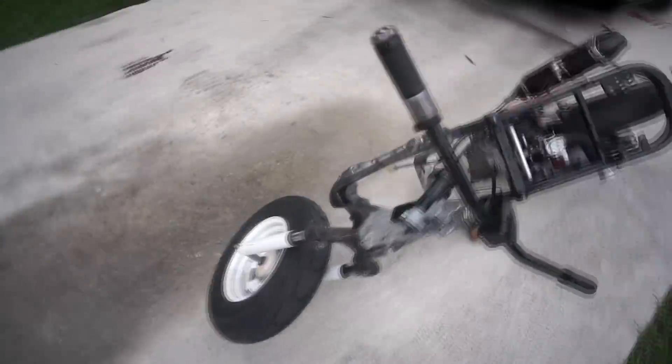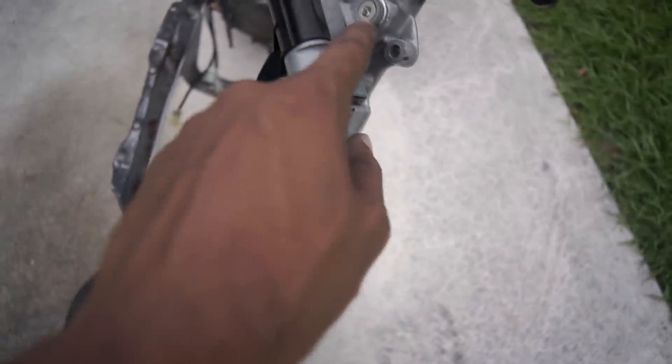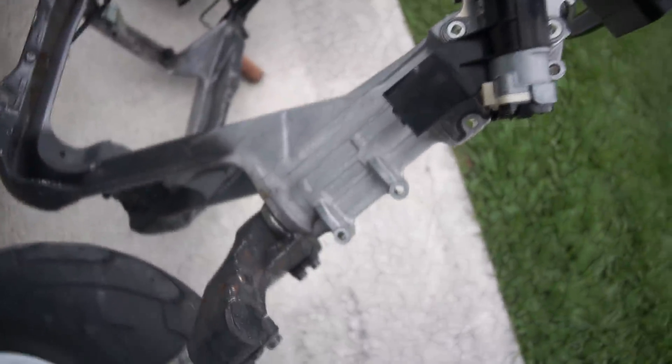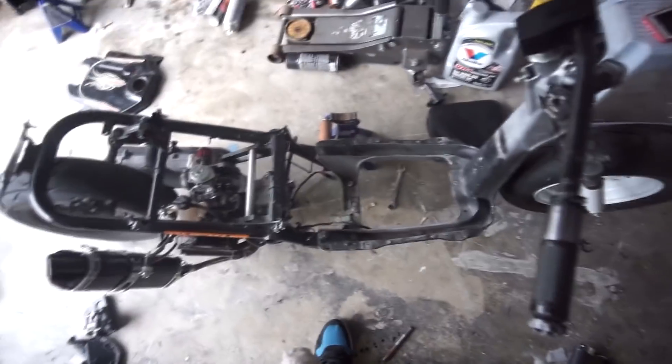Check out how the bike looks now — it looks like a bicycle with an engine on it. I still have to take off the stem. I watched a MotoCity vlog where he made a flathead slot to remove it — I might talk to Ryan about keeping it on and just covering it when I get the frame painted. These little Ruckuses aren't that bad to work on. I'm debating whether to drop the motor this video or next. I think I'm gonna remove the stem, handlebars, loosen these two bolts and drop the frame, then next video I'll actually drop the motor and get it prepped for paint.